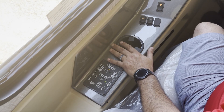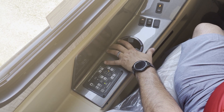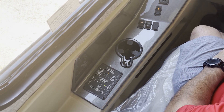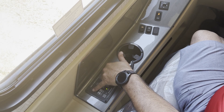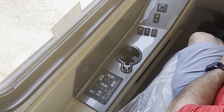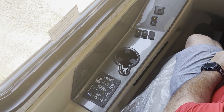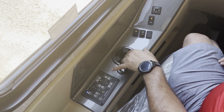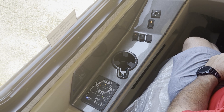On the HWH leveling system on newer products that still have the older style not controlled through the dash, when you pull up to your campground and you're ready, you hit auto level. As soon as you do, the first thing you hear is the system start dumping the air out. Once the air is dumped, the next thing you'll see is it starts putting jacks down, which you'll know by the little red icons in the four corners of the coach.